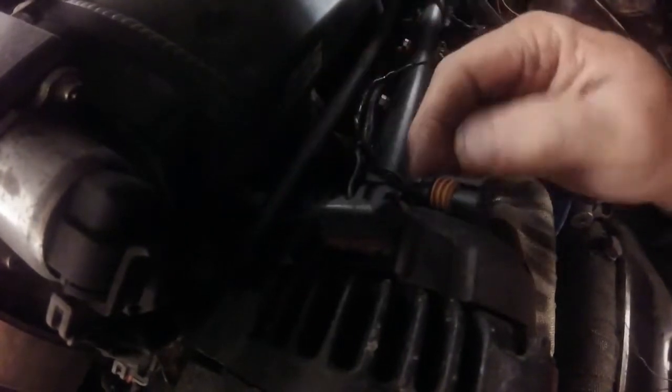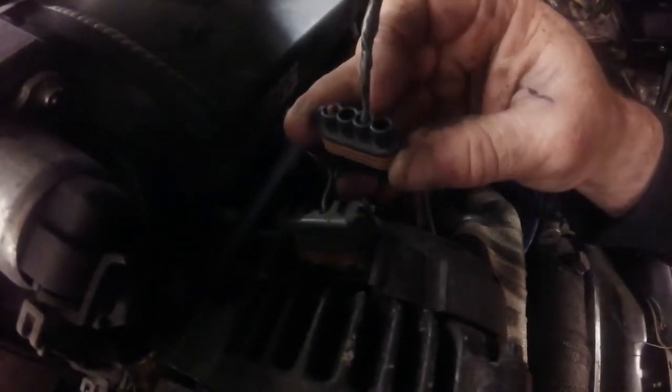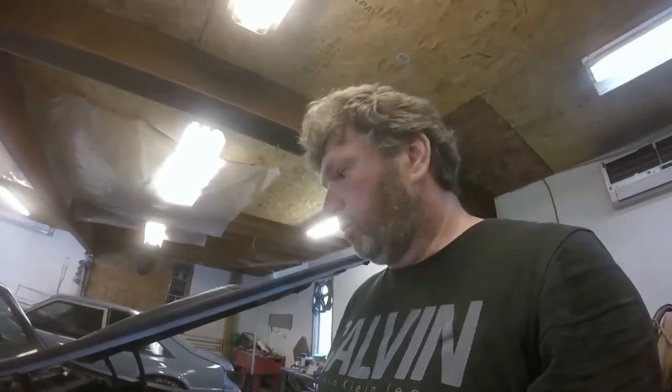You can see the connector — this little plastic piece we can snap back on here, it's not necessary but same thing: we have the wire coming out the second terminal from that side with the clip in the front. That's just how you hook it up. So back with the alternator after it's all set up, you run that wire to a switch live. Sometimes the old distributor wire for the HEI is a good source, or you can run it to any key live under the hood or in the fuse box — that'll be fine. When you swap the motor out and need to charge properly, if you don't do this it'll burn up the alternator. Just wire in the resistor and you should be fine.